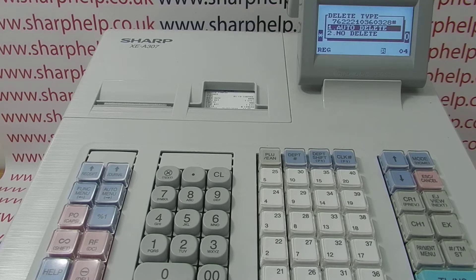You can also set it up to auto-delete or non-delete. Auto-delete is a feature where, if the barcode product isn't scanned for a certain number of days, the till will automatically delete it from memory. I'll have another video explaining in more detail how you properly program a product, but that's the emergency programming to enable you to sell an item half-programmed in register mode.